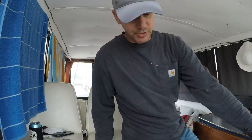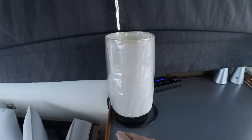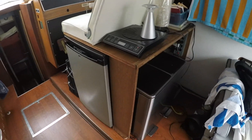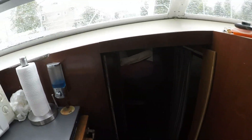If the AC panel doesn't detect enough draw, it shuts off — and there's just no setting or explanation for that. Hopefully there's an update coming to fix it. If it's cold out and the fridge doesn't run and nothing else is on, the AC panel just shuts off, which is frustrating. So here's a little trick: I turn on three lights overnight. Even if that fridge doesn't draw enough electricity to keep the Anker running, those three lights do.